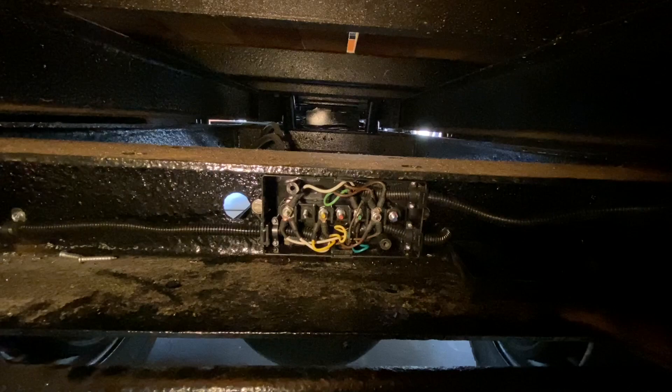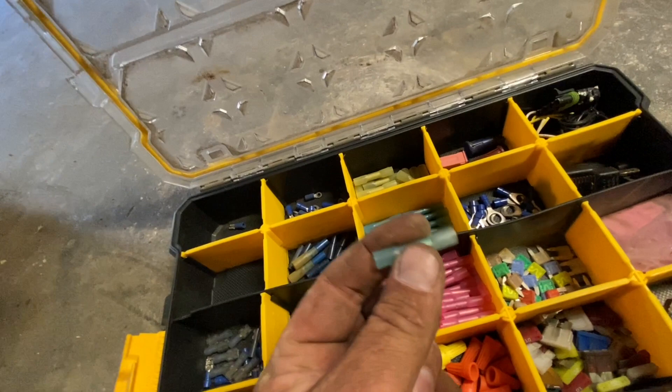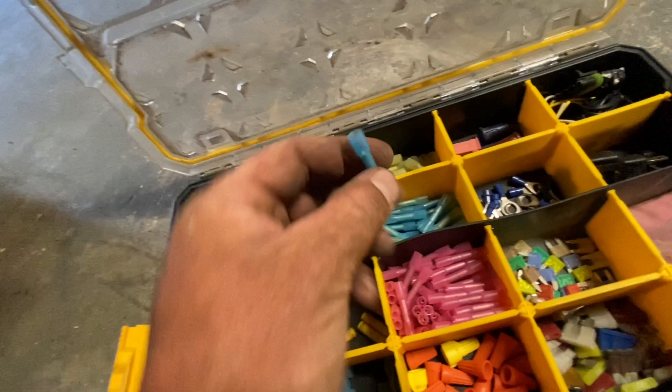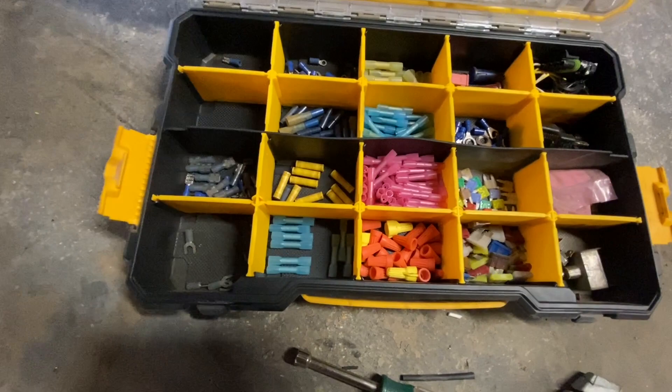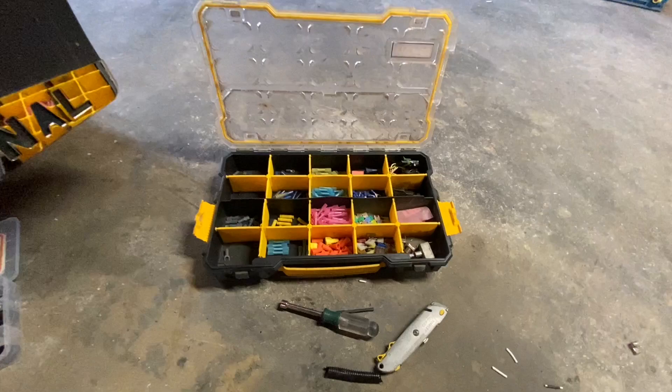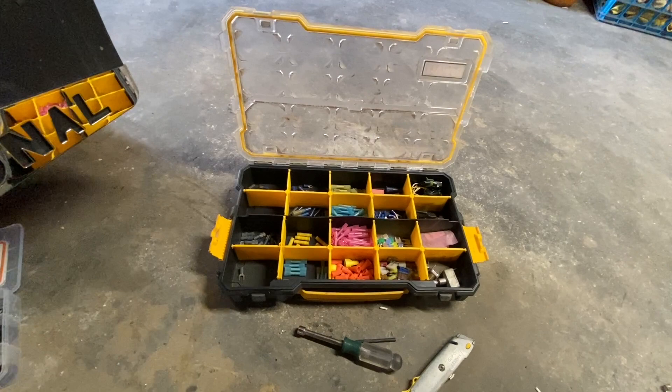Every splice on this truck has been a true Western Union splice, soldered and heat shrink tubing over top. There are no butt splice connectors. I love heat shrink butt splice connectors and I've wired multiple trucks and trailers with them, but they have a lifespan — significantly decreased by moisture and salt. What you will never see in my toolbox, because I hate them with a fiery passion, are scotch locks. They fail almost immediately when exposed to the elements. At least a butt splice connector is sealed somewhat, but they rely on a crimp that easily pulls out over time. This is all brand new wire, new sockets, every light — and I want good connections.